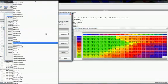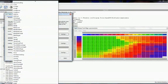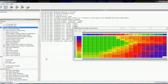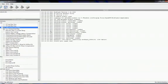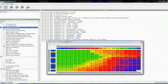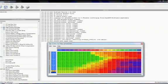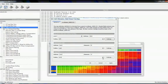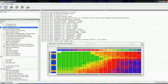If we were to change this scaling to something other than RPM, we would see an entirely different set of data. So now you can see we just get some funky values in here. And this is because EcuFlash is basically misrepresenting what the ECU has in that address. So it's important to see that if your data doesn't look correct, it could be a scaling issue, because otherwise EcuFlash doesn't know how to present this information to you. So let's just go back here, edit this map, change it back to RPM. Close this and go back in.